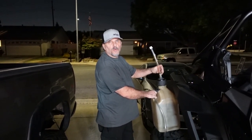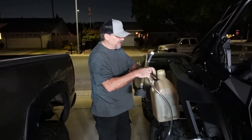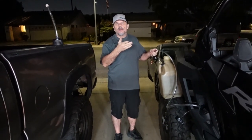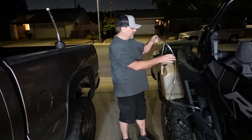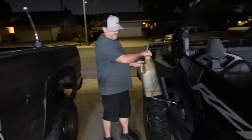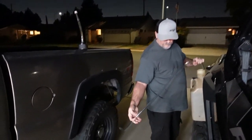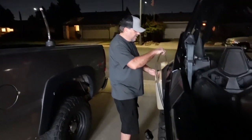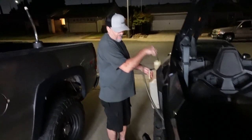Yeah, what happens is we're not burning very much fuel. We're not riding right now, so we're doing 0 to 60s, and that's it. So we mix up 5 gallons, and then we don't use it all, then we take that 5 gallons out to mix with our next mixture. And the cycle continues. Basically, we're not in that horsepower-robbing sand, just running on asphalt on dirt tires.